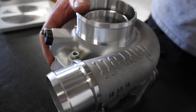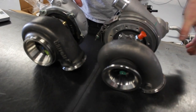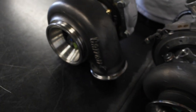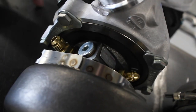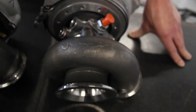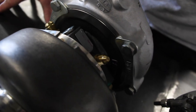The boost pressure port means you don't have to drill into the side of your brand new turbo, which is what you used to have to do. Flipping them over, they are quite similar in terms of core design — both have two ports either side for coolant, both come with a built-in restrictor, and both have exactly the same oil return setup: two-bolt or drilled and tapped for a dash-10 style return. A slight advantage on the G-Series — it comes with a dash-6 fitting both sides for coolant, which on high-end aftermarket or race car setups is really nice.